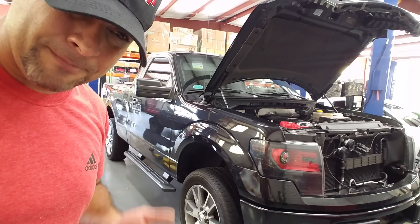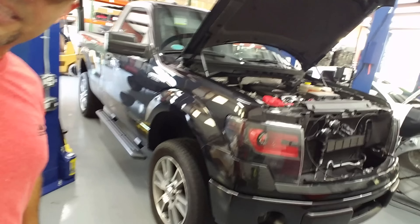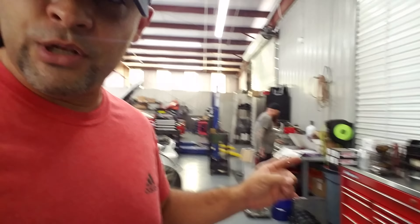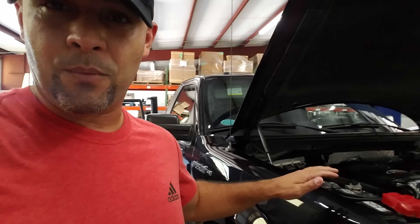For you guys out there with F-150s wondering what to do — here's what I'd recommend: for cams, stock cams are fine, Boss cams are good, and Comp cams are really good. You can also do an intake manifold upgrade like the Cobra Jet or the Boss — but remember, with any higher-rise intake you're going to lose some low-end torque. We'll try to make that up in the horsepower range. The intake cam is the biggest difference between this and a regular Mustang coyote. Long tubes, free-flowing exhaust, cams, and the intake manifold — it's going to be great. I'll update you guys once this truck hits the dyno with numbers. Stay tuned — hopefully within the next week or so. Thanks for watching!